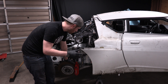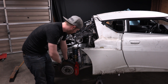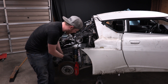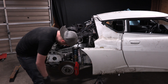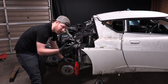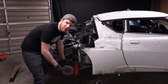It's not off by much though. The good news is that these points are very accessible and easy to work on. The subframe overall looks totally fine, so I'm not replacing the subframe — but we will need to modify one of these mounting points, either bend it back or modify the mounting point bracket. It's about a quarter to a half inch off. If you could take the back mounting point for the lower control arm and move it out half an inch, we'd be back on track. It's not the end of the world by any means, and it's really great that we can access everything from up here.